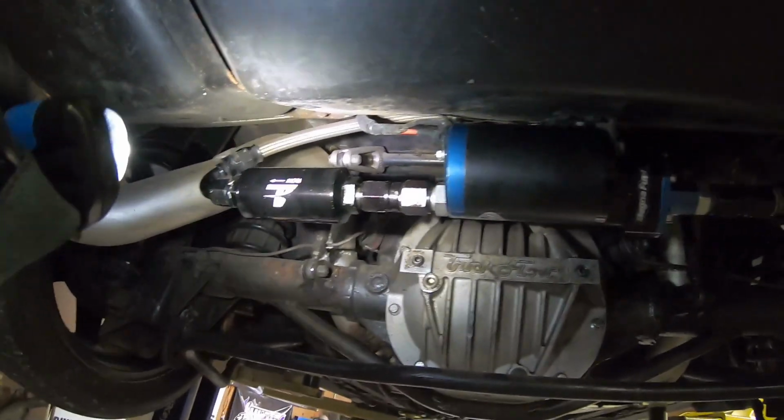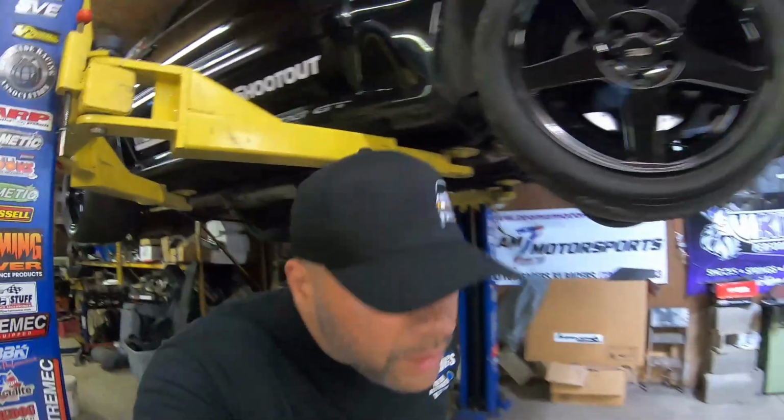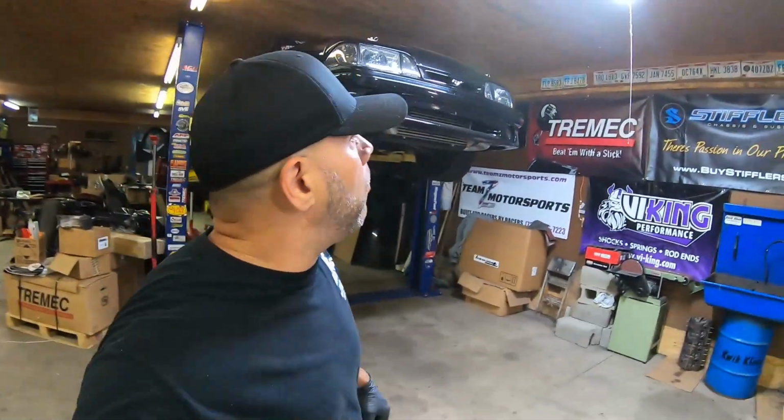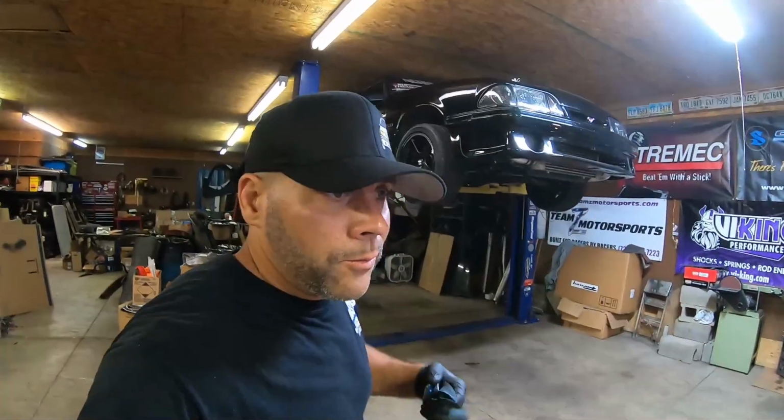We had to blow a little bit of debris out because this is a pre-filter. It's got a lot more microns in it than the post filter. These pumps over time, they just get a bunch of goo and garbage stuck up in them, and they wear out. Let's get some fuel in it and see how much more healthy it is and see if we got any leaks.